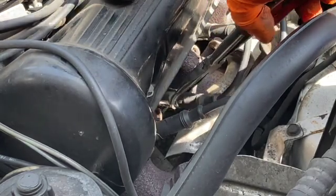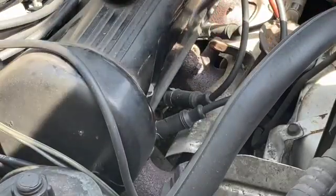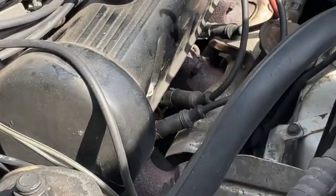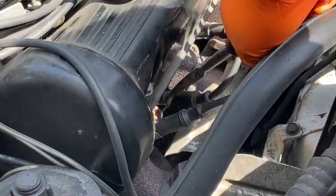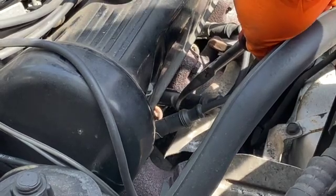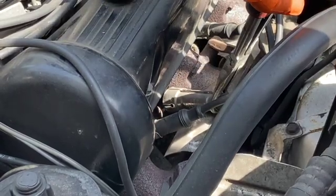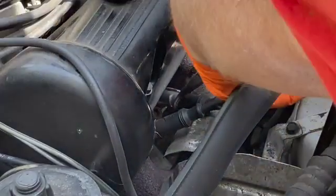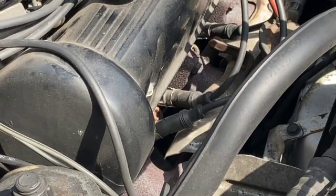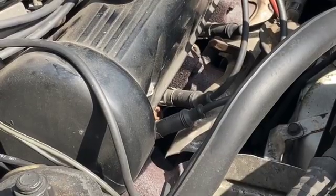Once you are done testing a cylinder, you put it back and you don't do this for long — just as long as it takes to troubleshoot. At least you know it might actually be something about the spark plug. Here is it with the engine running — runs very smooth. You take one off and all of a sudden the RPM drops, you can see it vibrates more, and you can actually see the spark jumping over to the engine part.